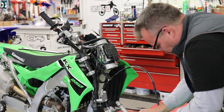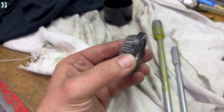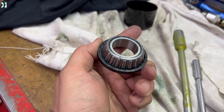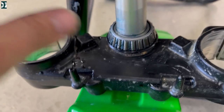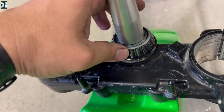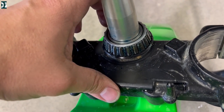So we are taking out the steering stem, and when I show you the detail here — look at the bearing. You can see some traces of grease, but this is definitely not fully greased. So it was really a good thing that we took it out. We're just gonna put the grease on the palm of our hand and keep going, greasing everything. Even the bottom doesn't look amazing, so there is definitely room for improvement. We're gonna get a little grease and fill everything up.